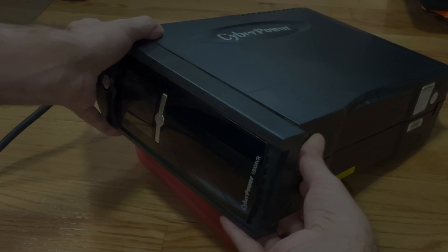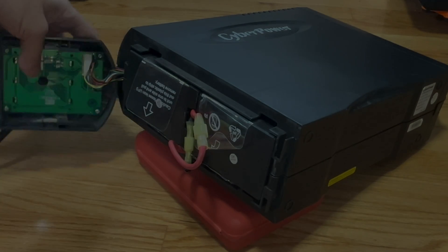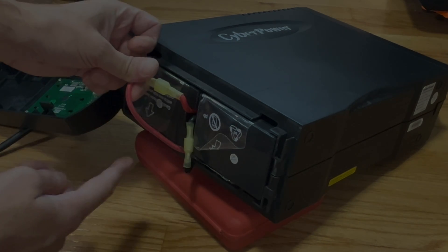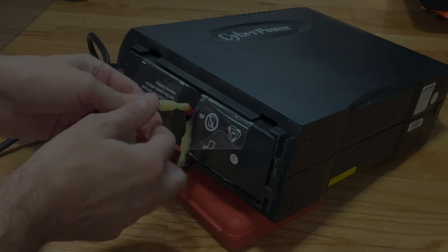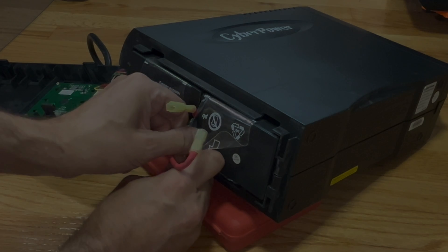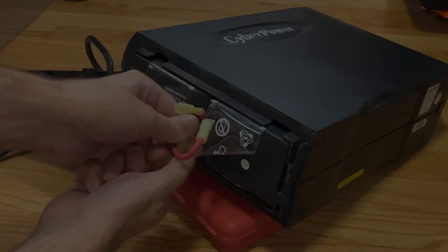While we're having the whole device sitting on its side, you slide it down and then we can tilt this away. Be careful not to rip off those wires that are connected to the display. Now we have here two really big wires that are connected and have connectors — we're going to detach those two connectors.